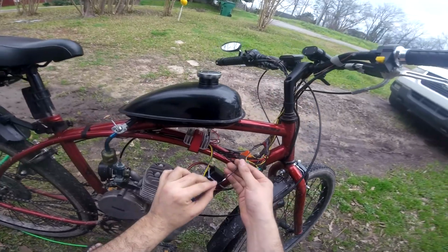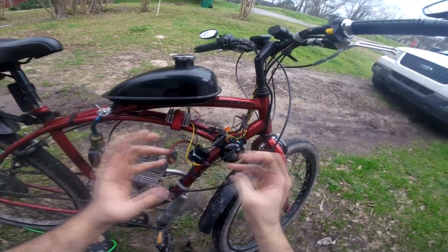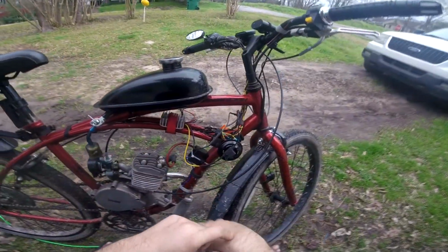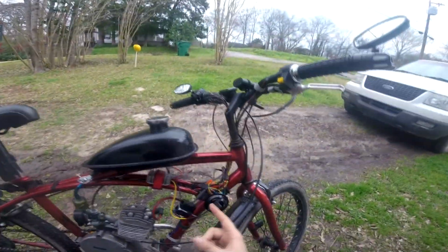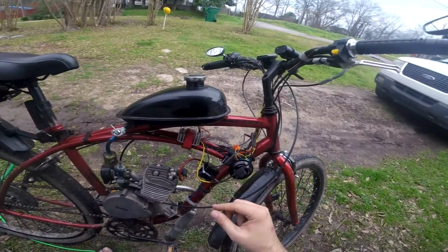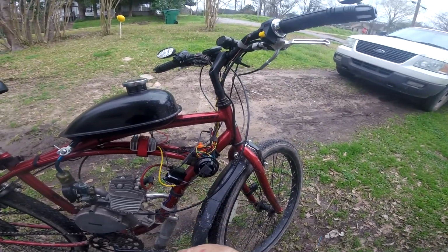So if you're not able to solder something together real quick, you lose your flux and your solder doesn't want to stick to itself and the wire as easily. You can still solder things without it, it's just not as effective. And one of the things that happens once the flux runs out is you get those sharp edges as you pull your soldering iron away. Those sharp edges are real good at poking through a heat shrink. So you want to get rid of those if you can.